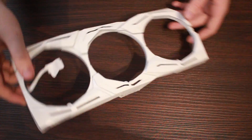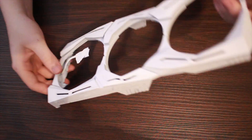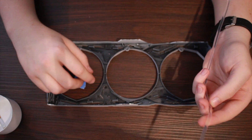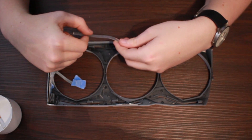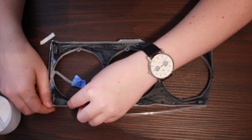Okay, so the painting process is done. Let's take a look. The front of the shroud itself has turned out actually very well — it's nice and even, with basically no imperfections. The sides, however, are a bit of a different story. Remove the masking tape by using your scalpel to cut the paint from the tape so it doesn't peel off, then use the scalpel as a lever to take off the painter's tape.